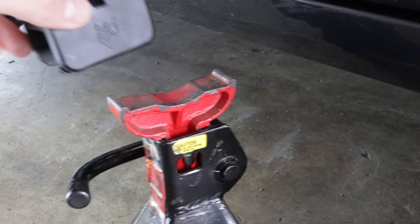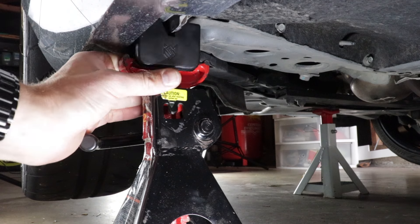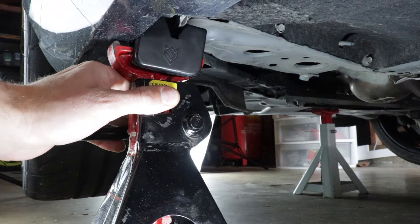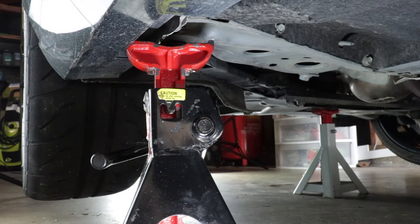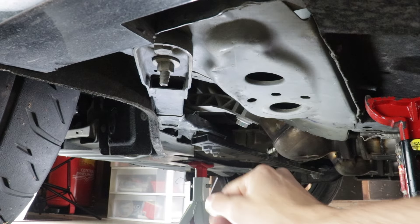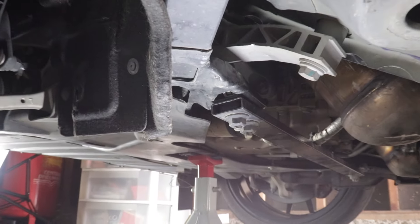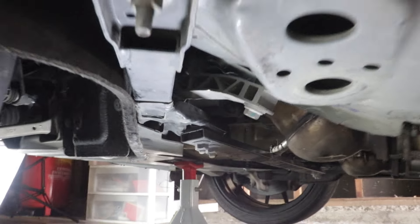There are also pinch weld adapters for jack stands — I picked these up off Amazon. They're really neat and you can put your jack stand under the pinch weld and they fit right up in there. Unfortunately, with the CTS and ATS, the plastic rocker panel extends below the pinch weld, so when you actually set the vehicle on the jack stand the metal part of the jack will touch the rocker panel and damage it. So I just get rid of the pinch weld adapters and use the jack stands normally. You may want to put the jack stand elsewhere — that might be okay — but never put it over on this bar or the attachment point. Many people have had this section damaged, causing the bar to touch the transmission, and then you've got a noise that's very hard to pin down. It basically amplifies the noise of the transmission. Many shops have raised vehicles this way and have bent the bar — luckily it's easy to fix.